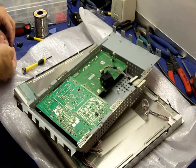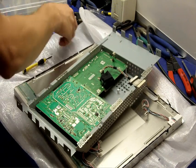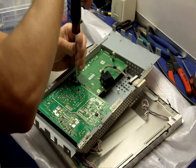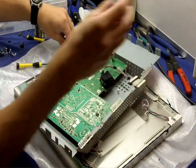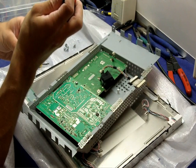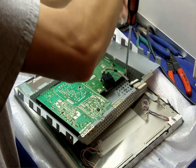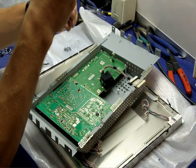Here's where you want to get your screws with the washers out. Pay attention to the one that has teeth on the washer — it will only go into one spot, right where the two boards come together. This post has a larger hole; that's the one where the toothed washer goes. The other screws will just go straight into the other posts. Be sure you've got that connected appropriately, because if you don't pay attention it will not go into any of the other posts.